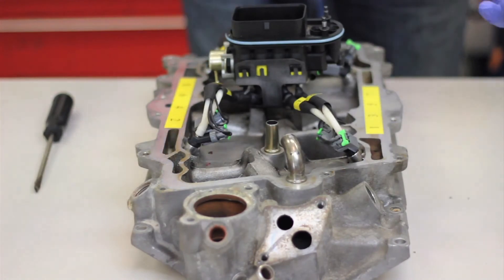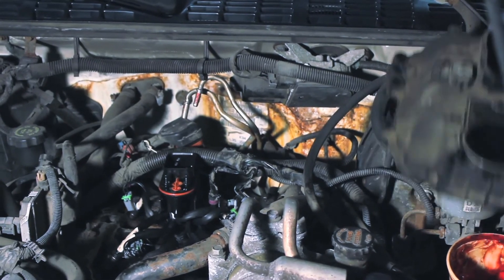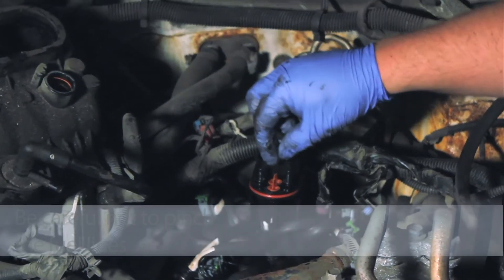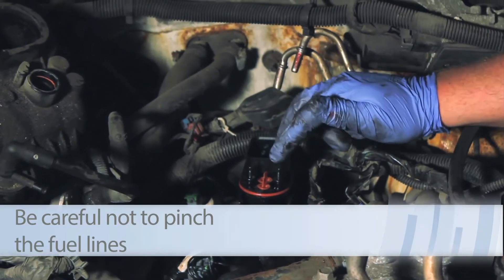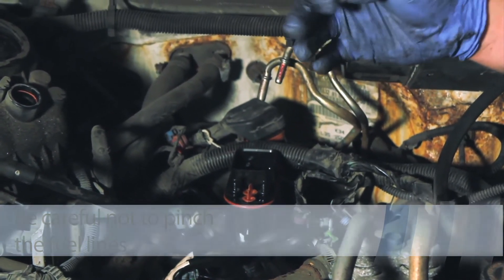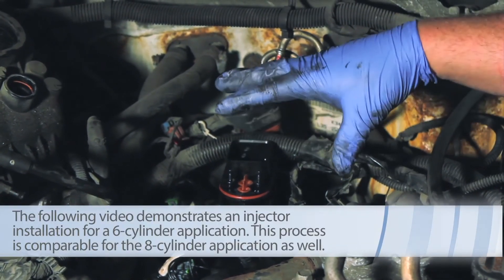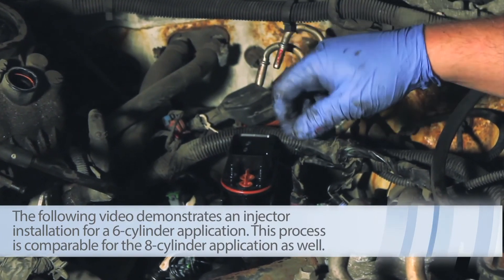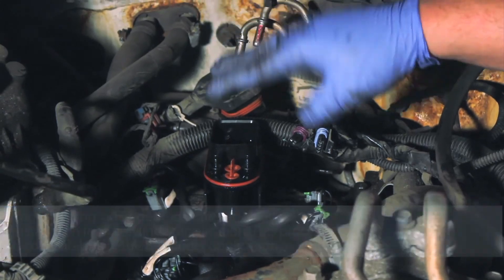Once they're all locked in place, we're all set to install the upper plenum and complete the job. We've done a good job lubricating and installing everything properly, so we can go ahead and install the upper cover. Once that's installed, remove the two small plugs, slide the lubricated fuel lines in, finish installing the throttle body and cables, plug everything back in, and the vehicle should be ready to go. Hopefully now you have a better understanding of what it takes to replace the fuel injector unit with this updated design on a 4.3 liter GM engine. Don't forget to clean it, don't forget to lubricate it, and be gentle when installing. Thanks for watching and enjoy your new fuel injector.